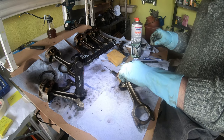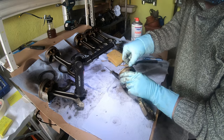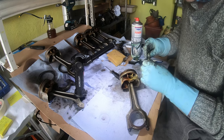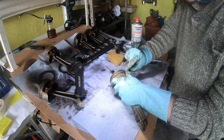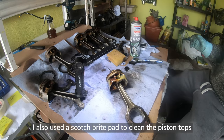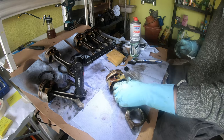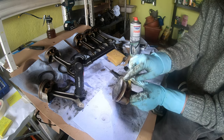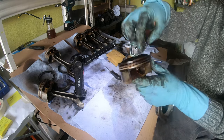The top ring, on either side of the connecting rod pins, has the most buildup — which makes sense because that's where they put the drainage holes on the new piston. It's pretty corroded all around the top pin. So I go with the steel brush around the edge, scrape it all off, then hit it with some brake cleaner. That's my process. Now seeing these pistons up close, I think the worse your valve stem seals get, the more oil you burn, and the more burnt oil gets stuck in between the ring gaps. Look at all this carbon buildup.